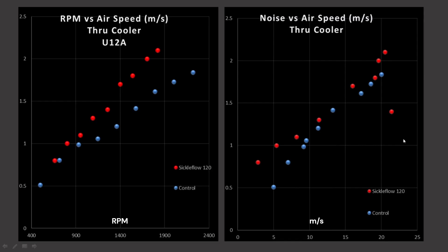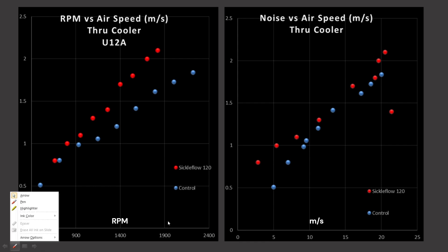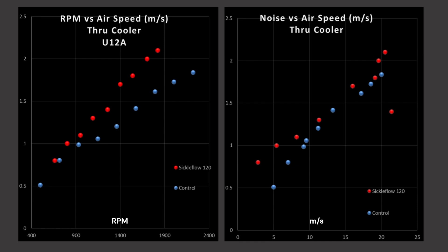Now we're taking a look at things through my CPU air cooler — the Noctua U12A. It is tested with one fan on the front of it blowing through it, and I measure the airspeed coming out the back. It is not in CFM, but it could be converted by knowing the surface area of the back of the fin stack. So we have airspeed versus RPM and airspeed versus noise level. The left graph is basically a blade efficiency graph — how good is this blade design at shoving air through that cooler? The right side is how effective is this blade design at being quiet while shoving air through the cooler.